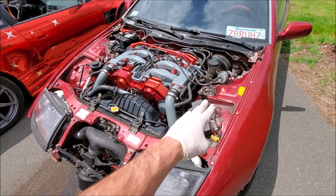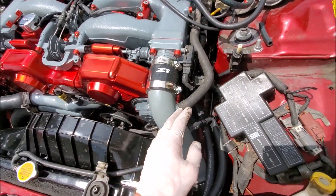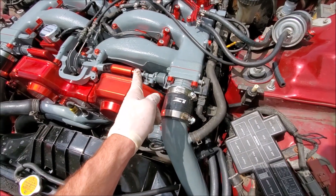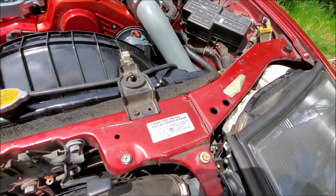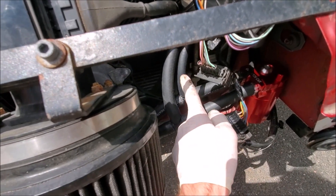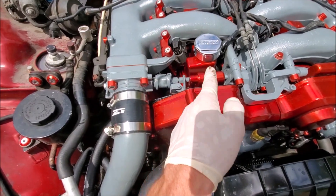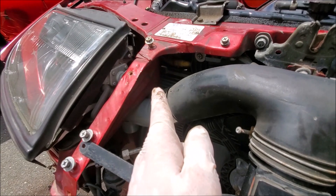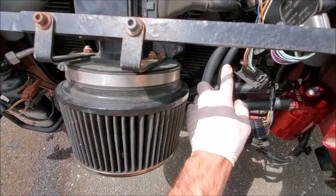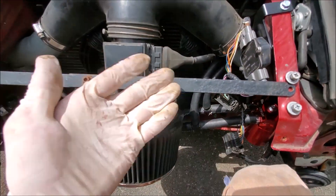This side's all done now — freeze plugs are both put in. Here's how I run my lines: we're going from the IN to the OUT. For the IN side, I have a line running from the driver's side intake valve cover, through a hole in front of the condenser, and that's my first IN line. My second IN line comes from the passenger side intake valve cover, down and around through the same hole on the opposite side, zip-tied to the power steering line, up into the T-fitting. Both INs go into the IN port on the oil catch can.